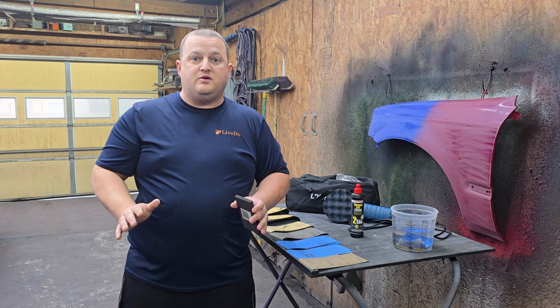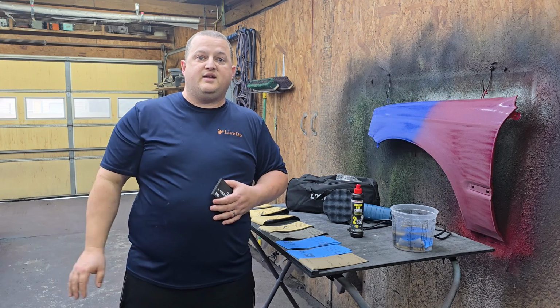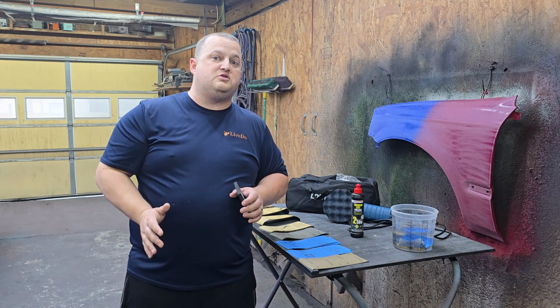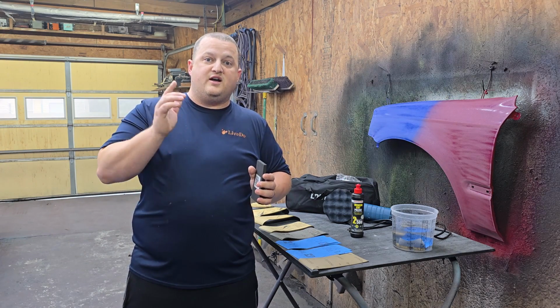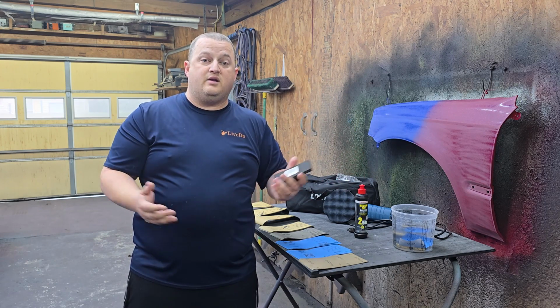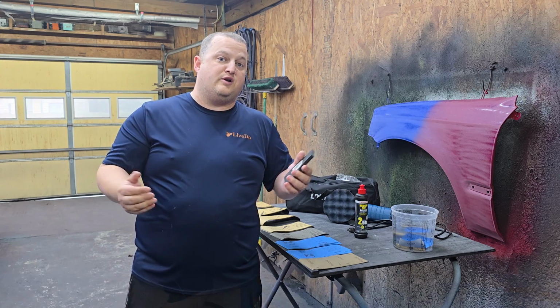There are many ways to do it. You can be super picky with this. You can spend days, weeks, knocking down everything step by step, going in 500 grit. There's so many ways you can do this, guys. There's a million tutorials on YouTube, but for purposes of this video, 1000, 2000, 3000, and then we're going to use some of this Meguiar's compound and polish to get everything out, and I'll show you everything step by step. So let's pick a section of the car and get started.